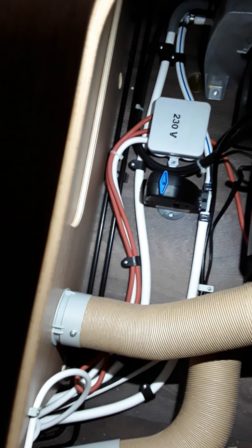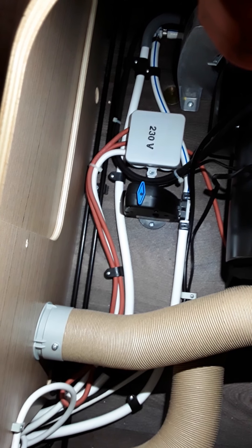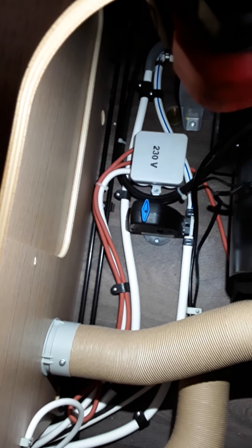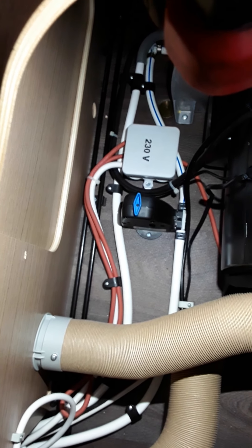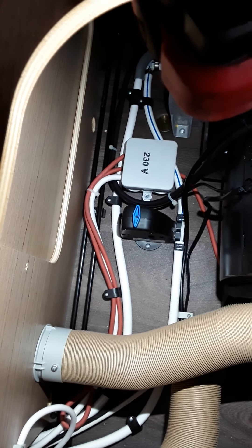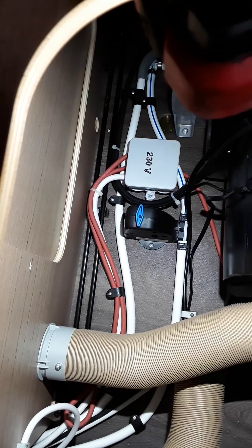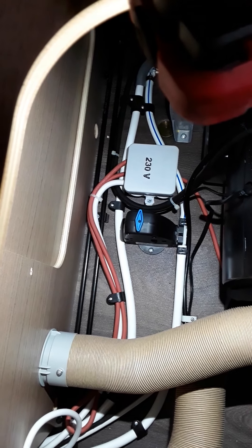As you can see, the button at the side is pushed back in once you turn that wee knob at the top back to position. If you find this button has opened during the winter in cold weather and the button won't stay in, it's because the van is too cold. If you run your heating either on gas or electric for about half an hour, that button will eventually stay in once you try it again.